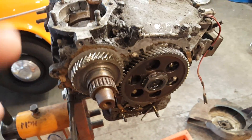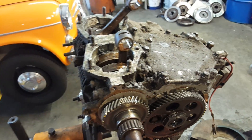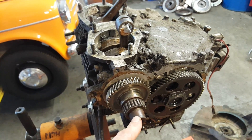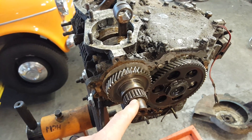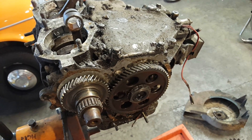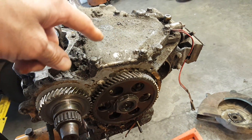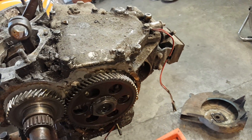This is a good example of how the drive gears work. You can see this is connected to the crankshaft — well, actually this would be connected to the clutch. The crankshaft is spinning all the time. When you engage the clutch, you engage this gear which then engages the drive gear for the transmission, and then off to whatever gear you select and out the output shaft.